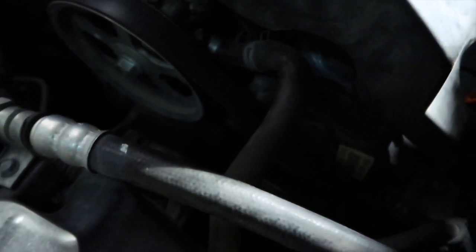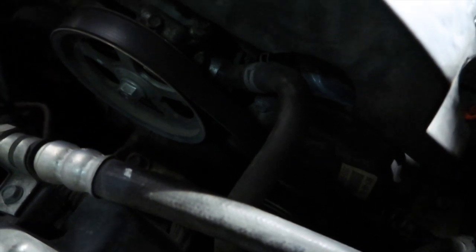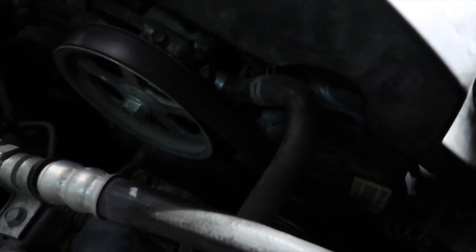Drain the transmission fluid. This cover that sits over here by this shell over here, make sure that you remember how it goes and put it back the way it goes. It goes on after you put that shaft. So put that shaft first, then put it on. I was having a problem trying to put it on. And then the shaft, I put it on. And then I was trying to put that CV axle in there, and it would not go on for nothing in this world. So I just repeated that and figured out what it was. So make sure that you put that shield, that CV axle shield, on after you place that CV axle in.